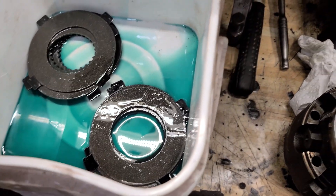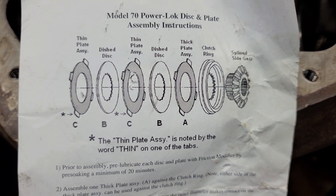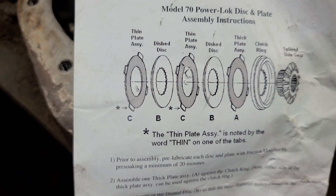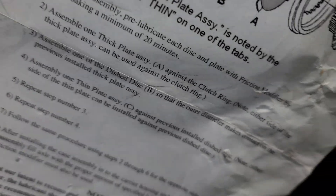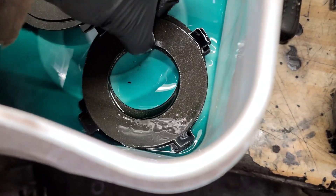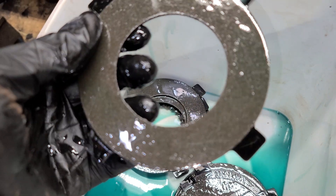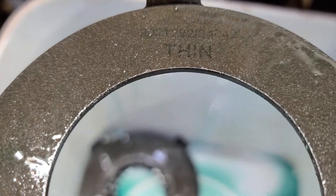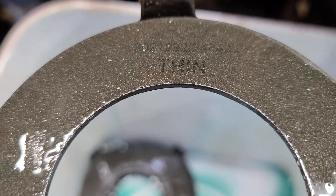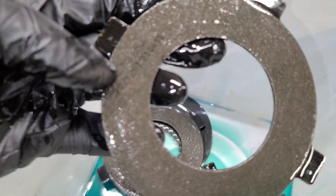Now they've been soaking for over 20 minutes and I'm ready to install. According to the instructions, you put the clutch ring in, then a thick plate, a dished disc, and then two thin plates. The instructions say the thin plate assembly is noted on one of the tabs — spoiler, it's not. When you buy a new set, if you look closely at the friction material it'll say 'thin' there. I assume that wears off. I've got four thins and two thicks; the thick ones just say the part number.